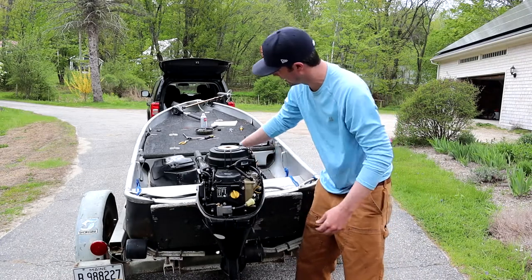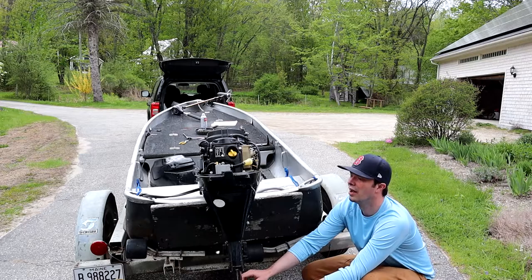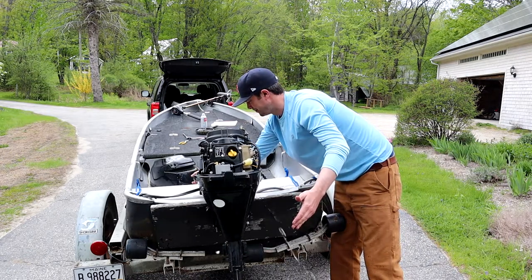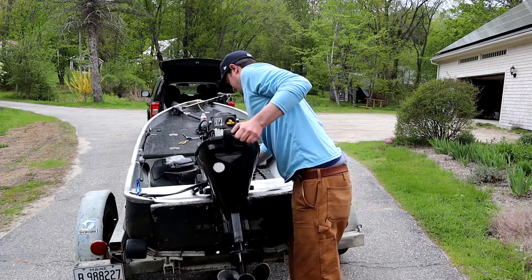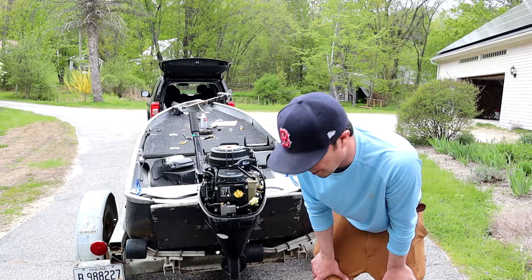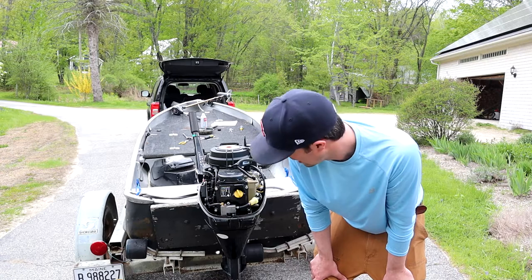All right, ultimate test, put the trim up. There we go, a little bit of water. And still. So, in the end there, when I put the trim up, it wasn't quite spitting out water, but I think that's due to just that these earmuffs aren't the greatest. They don't really fit that well, but when they were on and the trim was down, I haven't seen that much water exit in like 2-3 years, so I think it's all set.